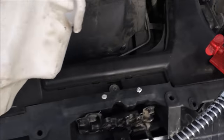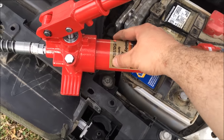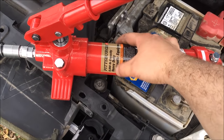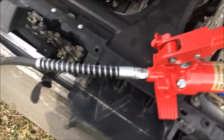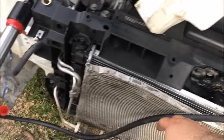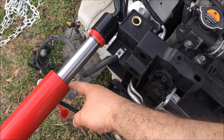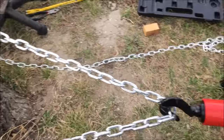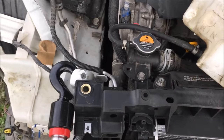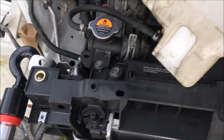The hydraulic pump capacity is limited — it is strong at 8,000 pounds or four tons — but the capacity of the fluid inside is limited. What I mean is: as I pump it, it comes to about this line and doesn't pump anymore. So I have to readjust my chain line to make it tighter and closer, then restart the process again.